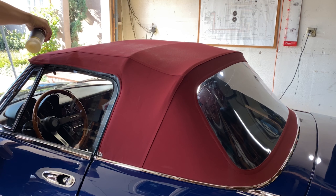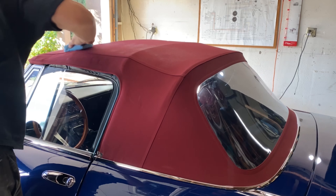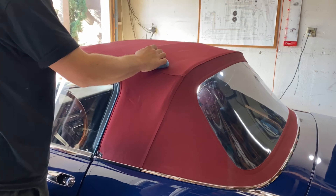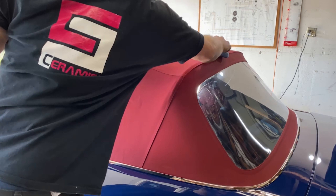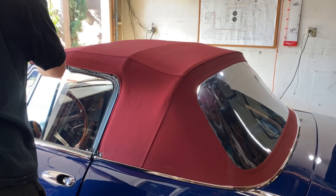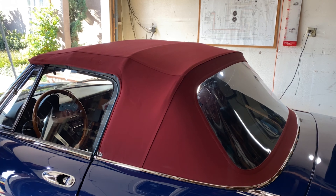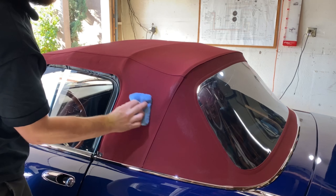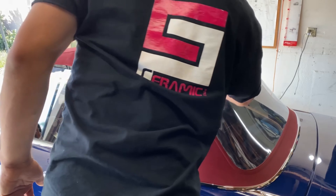Did you guys know there are coatings for cloth that can also be put on a cloth soft top? I'm using FineLab's textile cloth coating here today — I'll link to another video on how it works. My bottle is old and the sprayer is wonky so I'm spraying it onto an applicator and wiping it on. Work it in with gloves, wait until it dries a little bit, and apply a second layer to ensure you get a hydrophobic effect. It's a pretty cheap product available to both consumers and professionals, very hydrophobic, probably lasts 6 to 12 months. It will bead water off — it won't save you from spills 100% like Scotchgard, but it can definitely help if you get water off within the first 30 seconds.